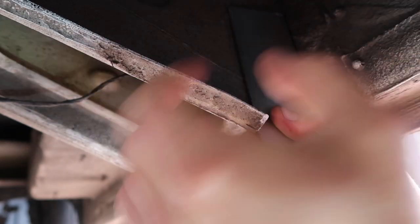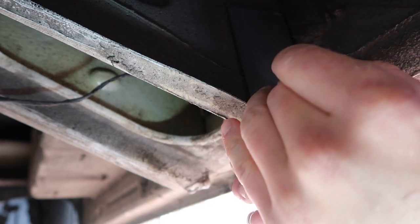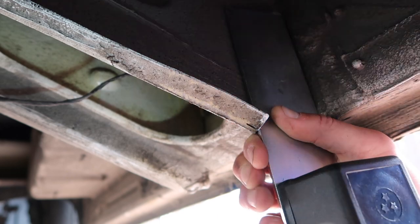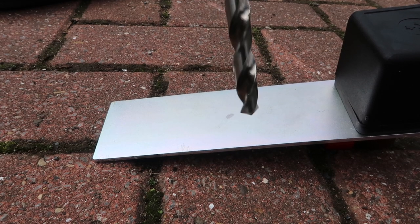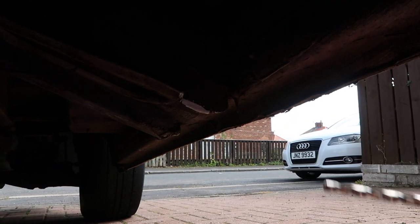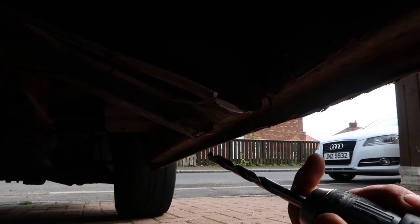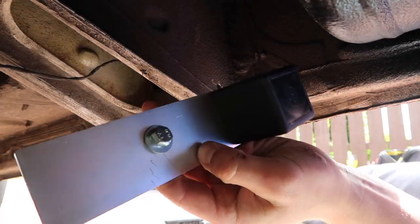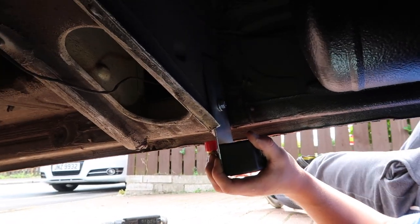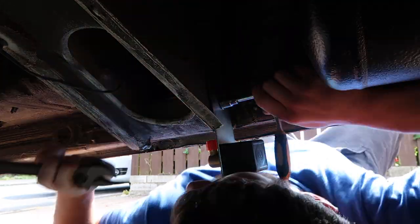That's where the bolt is going to come through — offer up your bracket. You can feel one side with your finger and the other side with your thumb to feel where the bolt's going to get a good fixing through. Mark where you're going to drill with your pencil, then drill the hole. Once you've drilled, offer up your bracket and mark through the hole so you know where you're drilling on the van. Drill the hole, place your bracket in, use washers on both sides, stick a nut on there and crank it tight.